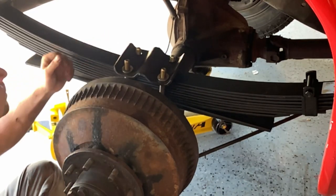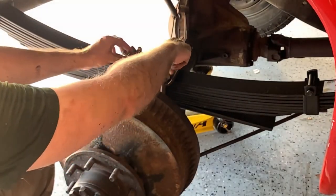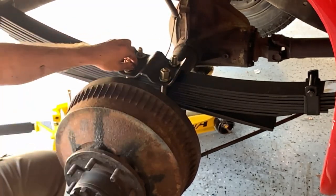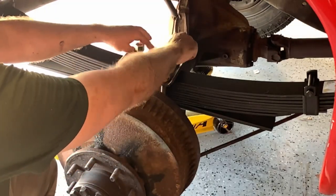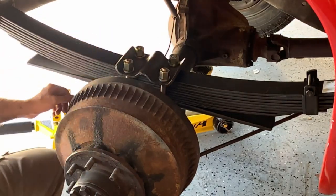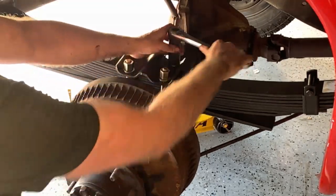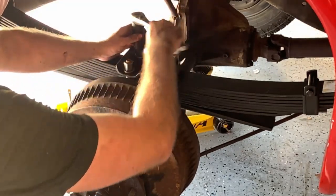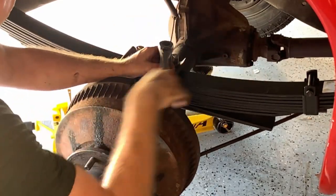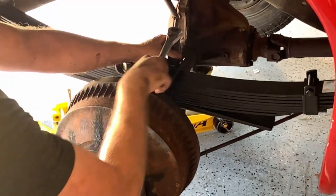You may also notice that where you placed your medium-strength thread locker hasn't quite gone above the plate yet — that also should rise as you continue to tighten them down. Hand-tight first, as far down as you can for each of the fasteners on top of the U-bolts, in order to help prevent cross-threading. Once you've had all of them down hand-tight, go ahead and start to use your socket wrench to tighten them. Give a little bit of tightness to each one at a time in a star pattern and keep a close eye to ensure that you're not shifting the U-bolts to one side or the other. Ideally at the end you should have about the same amount of height of the U-bolt poking out of each one of the fasteners.